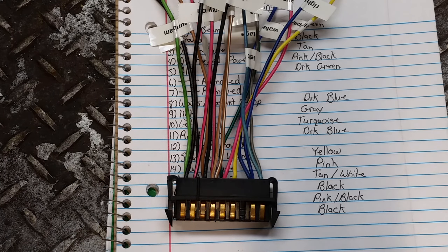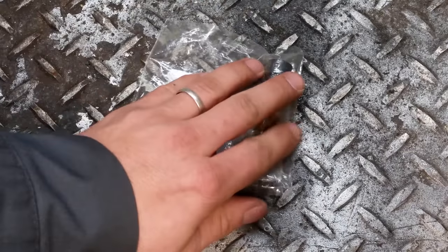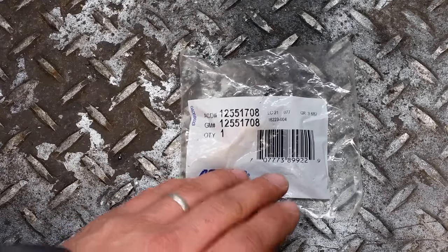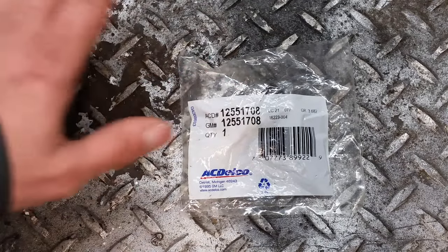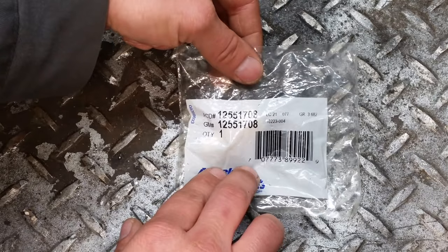In order to use this method, I'm going to show you a few things you'll need, and I'll give you some part numbers. The first thing you're going to need is this new water temperature sensor — it's a three-wire sensor. Two wires will wire back into the LS wiring harness, and the third wire goes to your gauge cluster, wired to the bulkhead for your temperature gauge. The part number is on the screen — you can screenshot that.